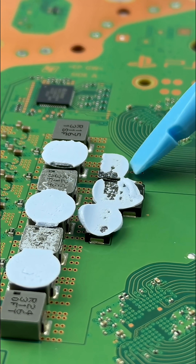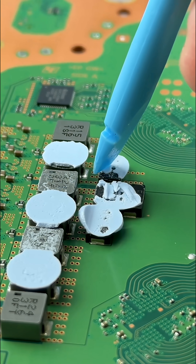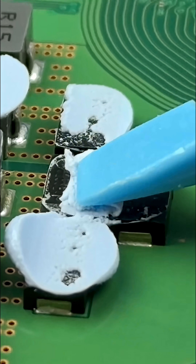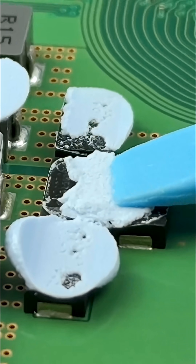Here's how to check if your thermal pads need replacement. First, do a visual check. Carefully lift a pad and look for dryness, cracks, shrinkage, tearing, or crumbling edges. Next, test compression. Press lightly. Good pads should spring back. If they stay flattened or feel too thin, they may not be making proper contact.